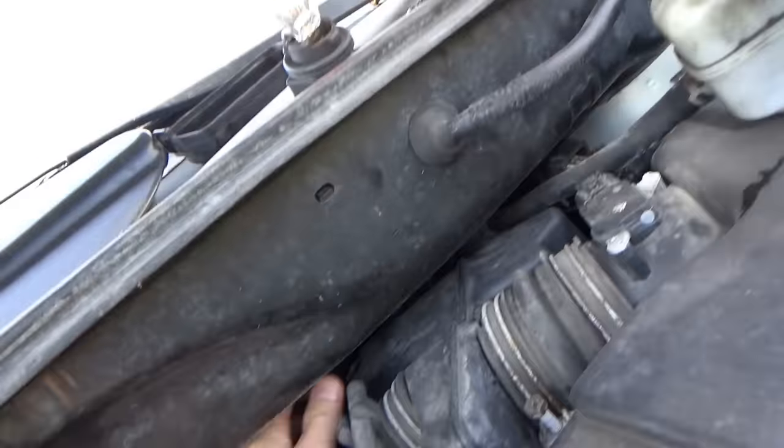So we can put the amp clamp somewhere over here to see if it's dropping down to here. We can put the amp clamp right here, maybe. Let's try it out. We gotta do the next easiest thing. All right, so I'm on the harness right here. It's gonna be hard to see because of the glare. About 0.2. If I unplug my test light, did anything change there? Let me reposition this a little bit so the clamps aren't around the entire harness.